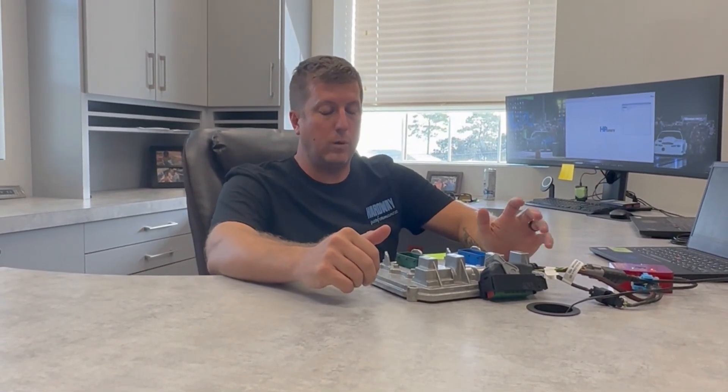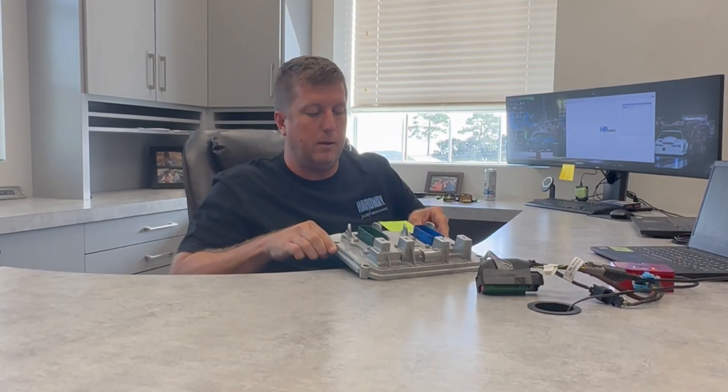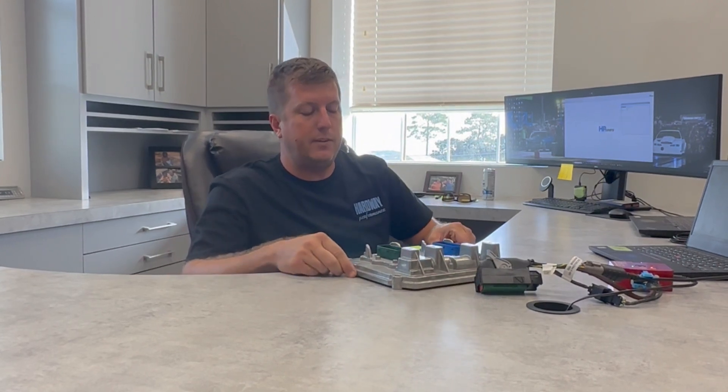This next step pertains to 2022 and newer trucks — this truck we're working on is actually a 2024 — or if you ever have to do a PCM replacement. From the HP Tuners readout, I can gather the necessary info needed to replace this ECM. This is the correct part number ECM, a CM2450 out of a 2019 to 2021 truck. I'm going to use our tools here on the bench to put the VIN number as well as the securities into this ECM, and then put it back in the truck and flash it with the stock 2024 operating system we just pulled out.